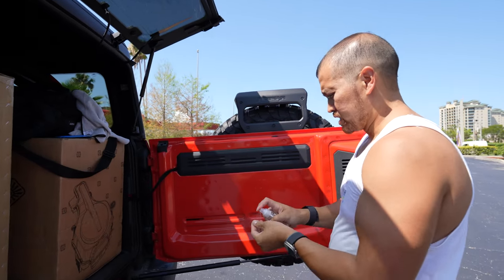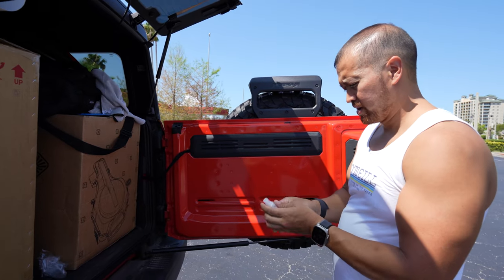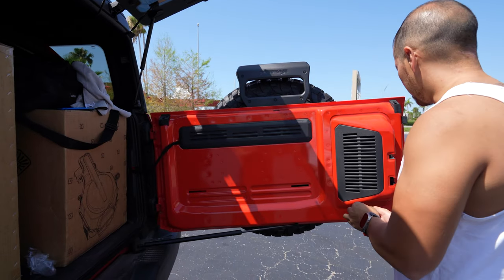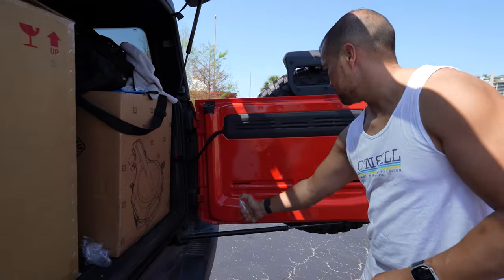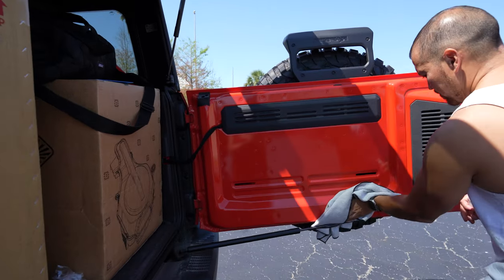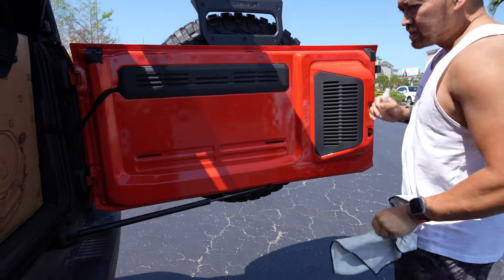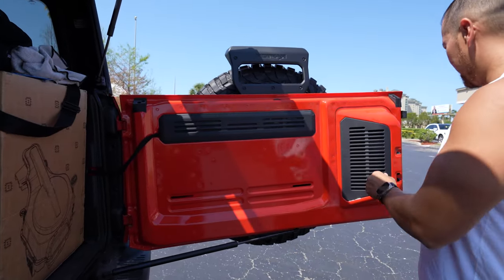What I'm going to do is spray my fingers down — that reduces the amount of oil that can be transferred onto the back of the PPF. And I'm going to spray down my install area, being pretty liberal with that. You can also use it to clean the area. You just don't want wax, ceramic coating, or anything to be in there because you want the PPF to adhere to this.